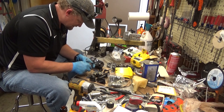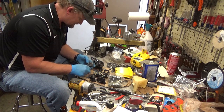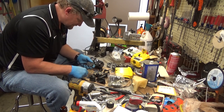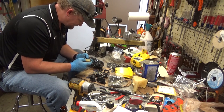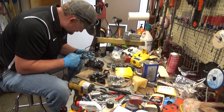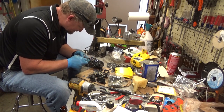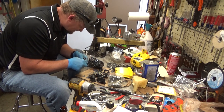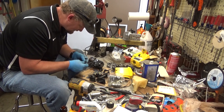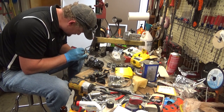That is one challenge when you get a saw in that you have no history on and it's completely disassembled like this. You got to kind of piece together, well, why did it come apart? What's the real issue? Okay, that diaphragm is still pliable. So what I like to do, especially on these inlet diaphragms, if possible, is carefully, without tearing it, get it loose from that main gasket and we'll get a new set on it, because they tend to kind of form a shape. They get a little bit inflexible.